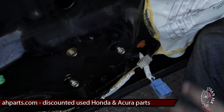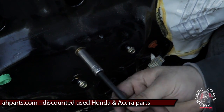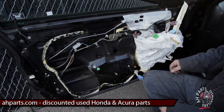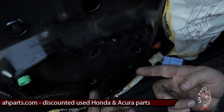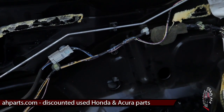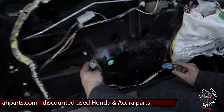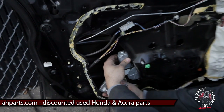Now we're going to go ahead and slide these bolts back through the holes on the door. This one right here I actually got to take out first — it has a washer on it, so remember where that one goes. We're going to push the regulator through the door, push the top one also through the door. On the left side you see that big hole where the door is — that's where everything pretty much comes out of. We've got to get the wires and put those through the door frame also, then the old part can come out the door.